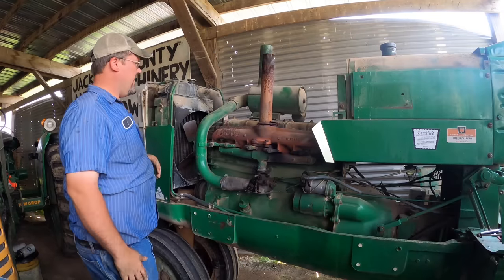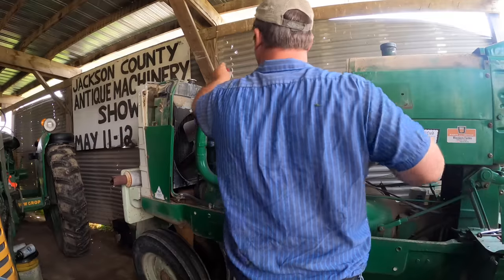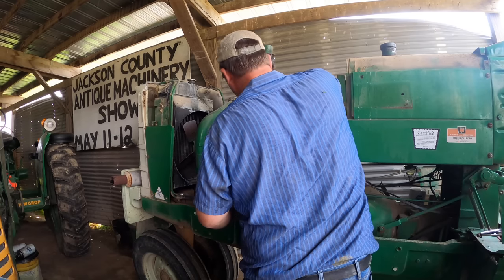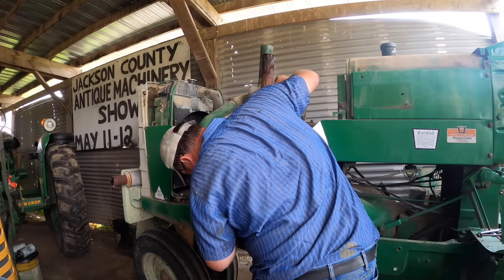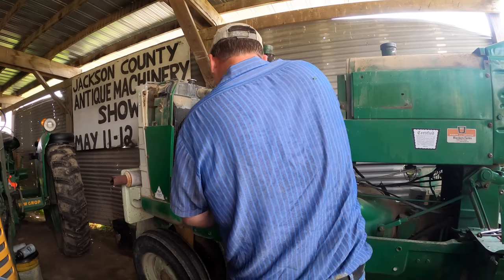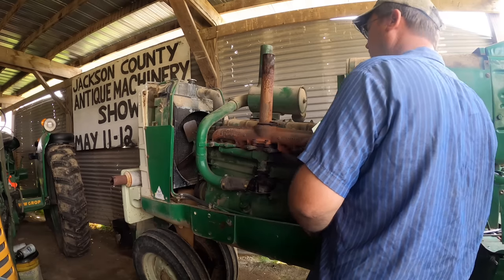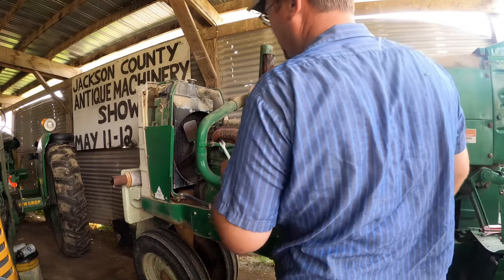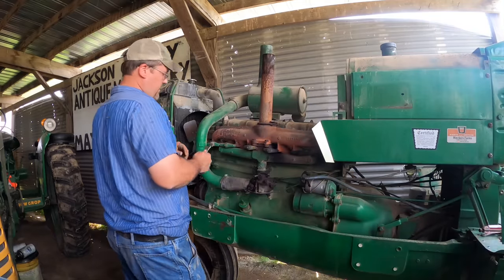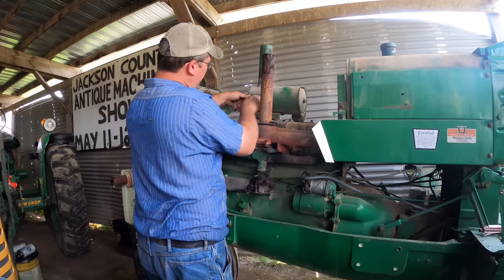Okay. Air cleaner delete time. Let's get right in the camera's way so you can't see anything. It would probably be easier just to take this all off so that we're not fighting around that pipe the whole time. You could take it off higher, but nah. Some of your early tractors, instead of having this tapered hose, had two short ends of hose and a cast piece that reduced it down. I'm not sure I have any tractors that have that anymore. That creeper drive tractor that I traded to Craig, I think, has that style with the cast reducer in there. I might have one in parts, but if I ever find that, I'll make mention of it. But anyway,